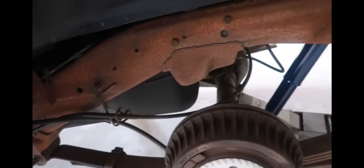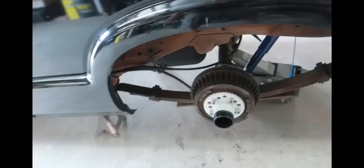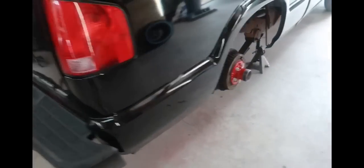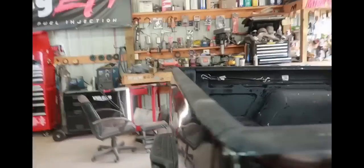Got the drop blocks in, three inches lower. See, it's all rusty right up in here. I'm gonna scuff that down with a Scotch-Brite wheel on the drill, put some semi-gloss black on it. There's the blocks right there, got those on, trimmed the bottoms off - good to go. Old school mini trucker stuff, the auto parts store drop kit. I took the rubber bump stops off, so hopefully the little S10 will be sitting on the ground right. We gotta clean that frame out, it looks bad.